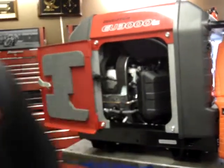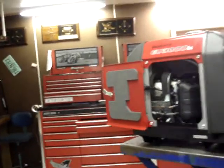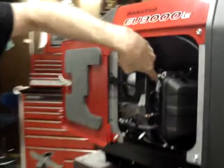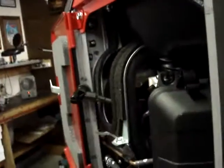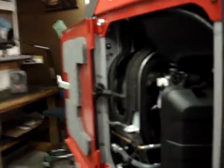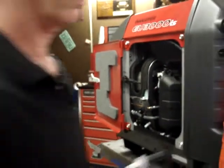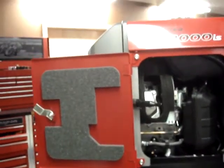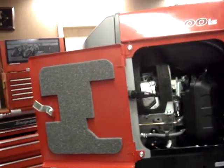And now for the fun part. Last key piece of the kit. This hose is going to fit through this hole in the heat shield where the original breather line went through, and then tuck in to the valve cover itself. So first I'm going to dip the end of this in just a little bit of oil. Again, it makes life easier on me.